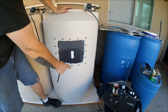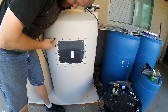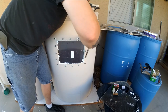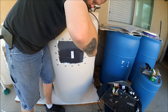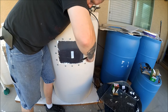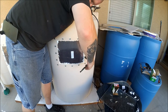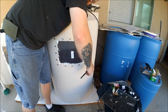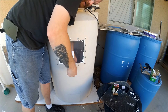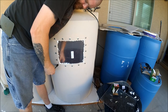Everything is installed. I've got the two initial bolts flipped around the correct way — all are hand tight right now. Going around with the socket wrench, just snug, not really tight. You can see some of the caulking squeezing out as I tighten these down. I'm holding the nut on the inside with my hand because if I use a wrench on the inside I could crack the plexiglass.